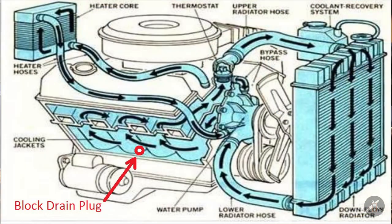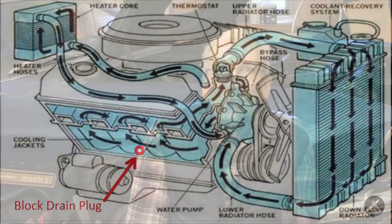I went to that heavy duty cleaner because I was getting frustrated to the point where I thought I was going to need to pull the engine and get in there with mechanical tools, rods, and knock all that stuff out. So my recommendation is: when you do coolant flushes, don't just do the top side. Get down underneath and take the time and trouble to pull those block drains. What I learned is you get corrosion, you get scale, and it all goes down into the bottom of the block — into the V under the cylinders in that water jacket — and it builds up. Over years, especially with a classic car, you can build up a lot of junk. When I do the Camaro next time, the block drains will come out, and I'm going to make sure all the sludge comes out of the bottom.